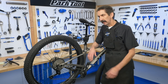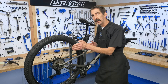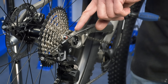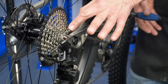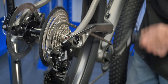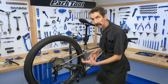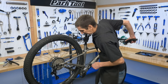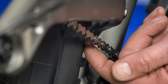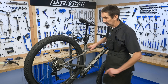There certainly is an industry trend for moving things outward, and it makes sense. But remember, it's the differential between the rear and the front that's really going to affect our shifting. Being biased outward in front, we are not going to be taking the chain and striking the neighboring cogs when we're out in our bigger gears. When you shift up to your easier, larger cogs, that's really not an issue. Now a shorter chainstay bike with larger tires, we're also getting good tire clearance. This here looks like a pretty big gap, but remember, with any luck we're going to have mud and leaves in here — it's going to get smaller and smaller. So clearance here is good.